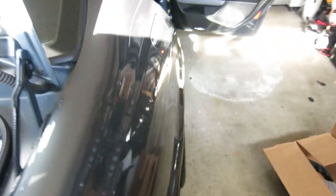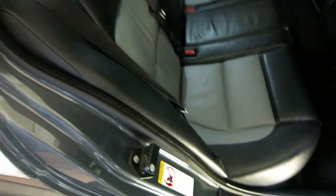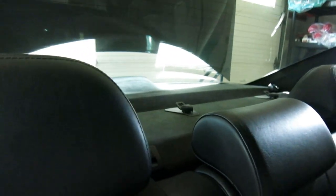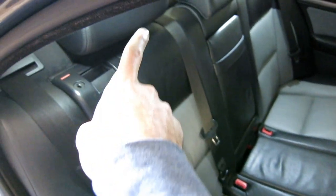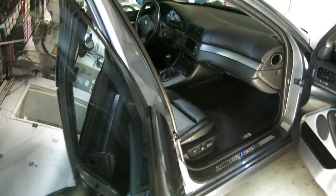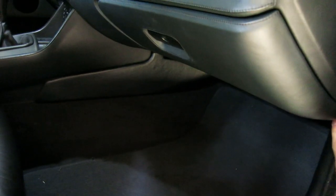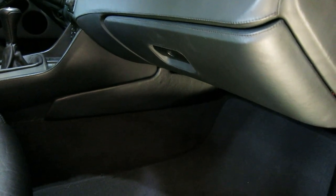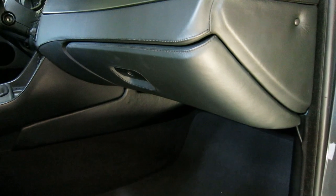It's going to go inside the car, and we're basically going to have to run the wires from here to the front of the car. The rear gong speaker is actually located under the rear deck up here. So the rear deck is going to have to come out. It screws into the rear deck and you're going to have to get it powered through the harness. The rest of the harness is going to run along the passenger side of the car.